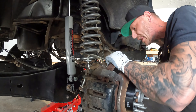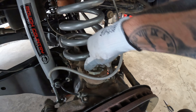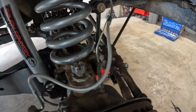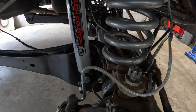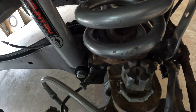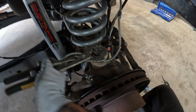The flat spot needs to be to the side of the truck. You just gotta push, get the weight off it, and make sure the slit is to the back of the truck. I ended up using a piece of wood and hitting it so I had more space. What I ended up doing was taking the factory bushing and flipping it — you can see where it broke from hitting it but it did go down nicely, and breaking it actually helped because it made clearance for the spring. I'll use that technique on the next one too. I don't have wrenches big enough, just a socket, and there isn't much room so I've been using channel locks.